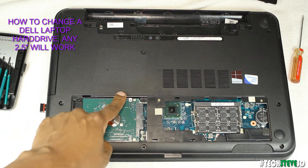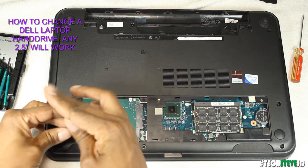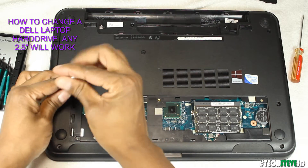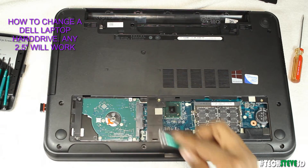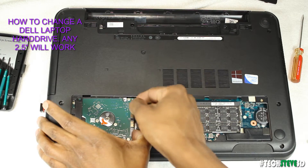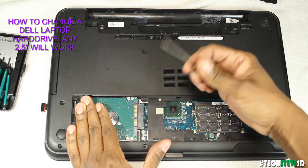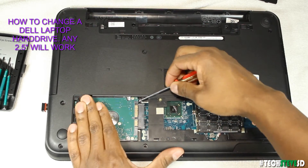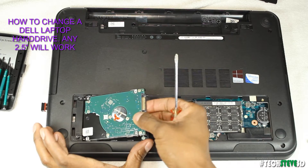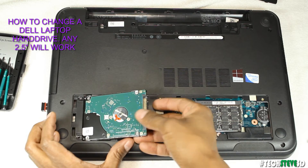Now the hard drive is located right here. You want to take these first two screws out and put them to the side so you don't lose them. Push the hard drive until it slides out and then lift it up a little bit. I'll use this little screwdriver here — there's a little tab here too. Just make sure you don't pull it too hard, get it out nice and easy.